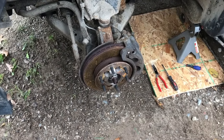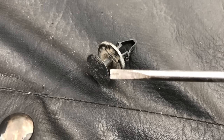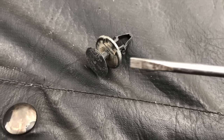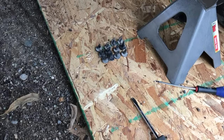We have to remove a tire. Once you remove the tire, make sure you have a jack stand supporting the weight, not the actual jack. From here, we need to remove this rain guard or splash guard — you'll see several of these little plastic tabs. My best advice when removing these clips: this portion here is the cap. See a little indent or groove? Grab a flathead screwdriver, insert it into that groove, and pop the cap out. After you pull the cap out, you can pull the entire clip out without breaking it. All 12 of those plastic tabs have been removed, and I didn't break a single one.